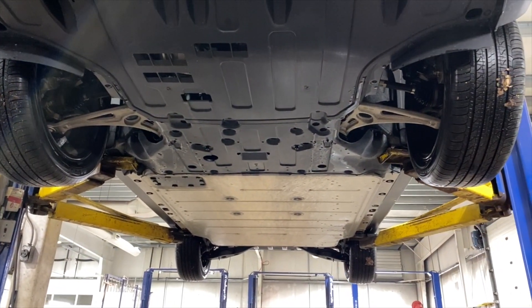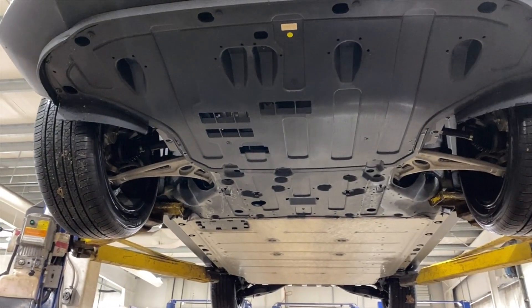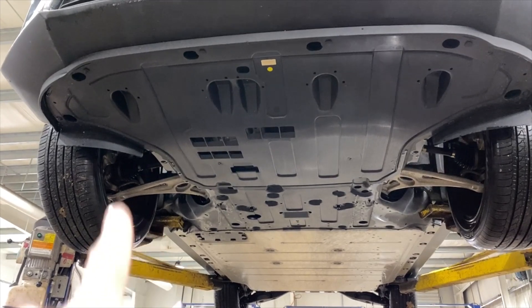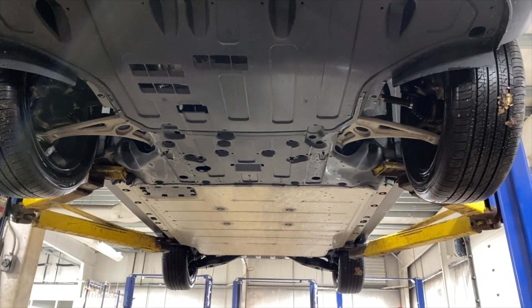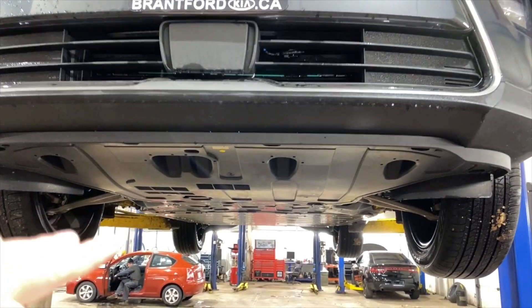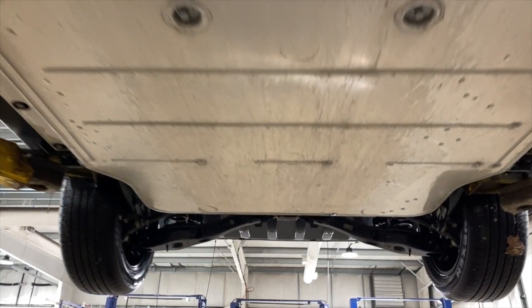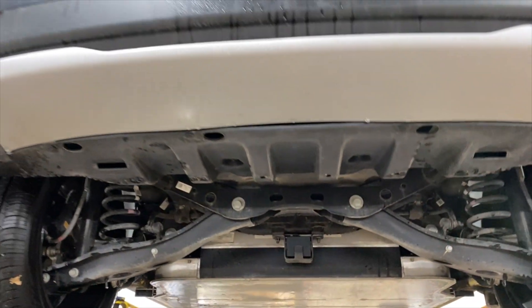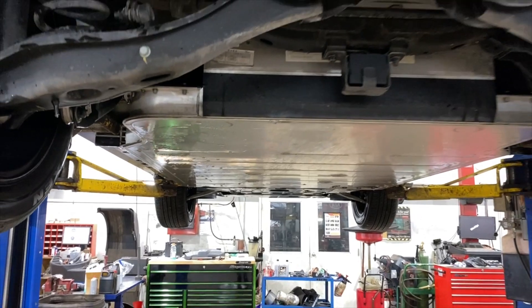One of the next things we do is lift the car in the air. I'm also here to get my tires swapped to snow tires. As part of the $69.95 package, we can rotate tires, which is important because of the high torque on the front wheels. Walking underneath the car, you can see the aerodynamic design — plastic shrouding in the front, a large shielded panel over the battery in the center, and more plastic shielding and a diffuser at the rear, with an aluminum shield protecting the battery.